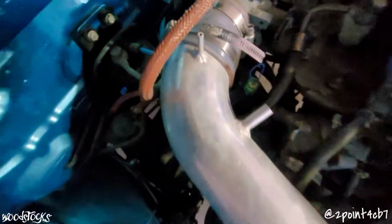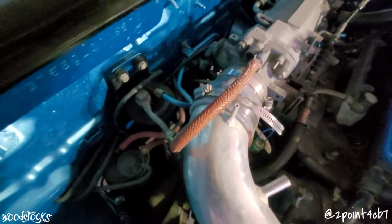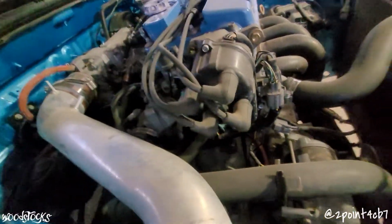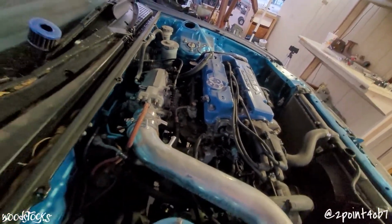Do some of the small things. I get my flathead and we'll get this intake taken off. Get a 12mm wrench and we will take the throttle cable off. We'll get these fuel lines disconnected. We'll get any of the vacuum lines and anything else attached here disconnected. 3 12mm bolts for the distributor. Any remaining plugs go into the head and the distributor. Pull that off. Then we'll work on the intake.